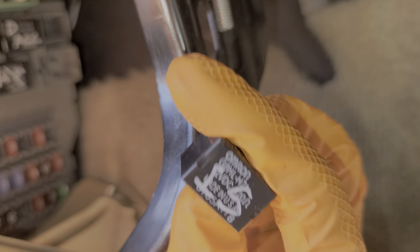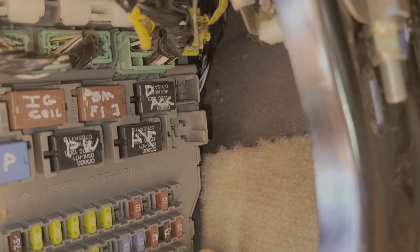Here's a closer look at the starter relay itself. The ignition switch provides power to the relay when you turn the key to the start position. The neutral safety switch provides a ground to this when you're in park or in neutral. Both of those must work together in order for this relay to get energized. When it does get energized, it takes that power from the ignition switch and sends it directly to the starter in order for it to be engaged.